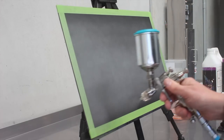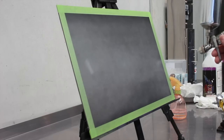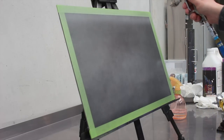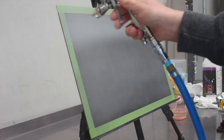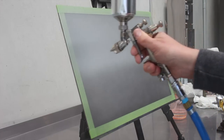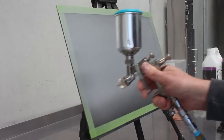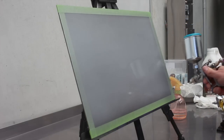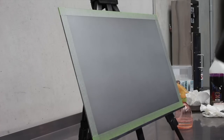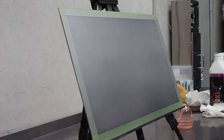You can see I'm probably maybe 15-20 centimetres away. The pressure is not super high because it's an HVLP, so I'll probably run it at about 30-35 psi — just gauge what you need to set it at to get the desired result. I'm doing a 50-50 overlap, meaning when I do one pass the next pass is 50% overlap onto the first, so the overspray covers the first pass by 50%. That way you don't get those sort of train tracks through your spray pattern.